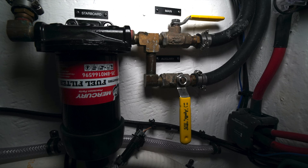To open the main tank, look at the label on the bulkhead and make sure the yellow handle is in line with the flow of fuel as it runs through the hose. When the yellow handle is perpendicular to the flow of fuel, that means that valve is closed. Right now we have these engines running from the main tank with the auxiliary tank closed.